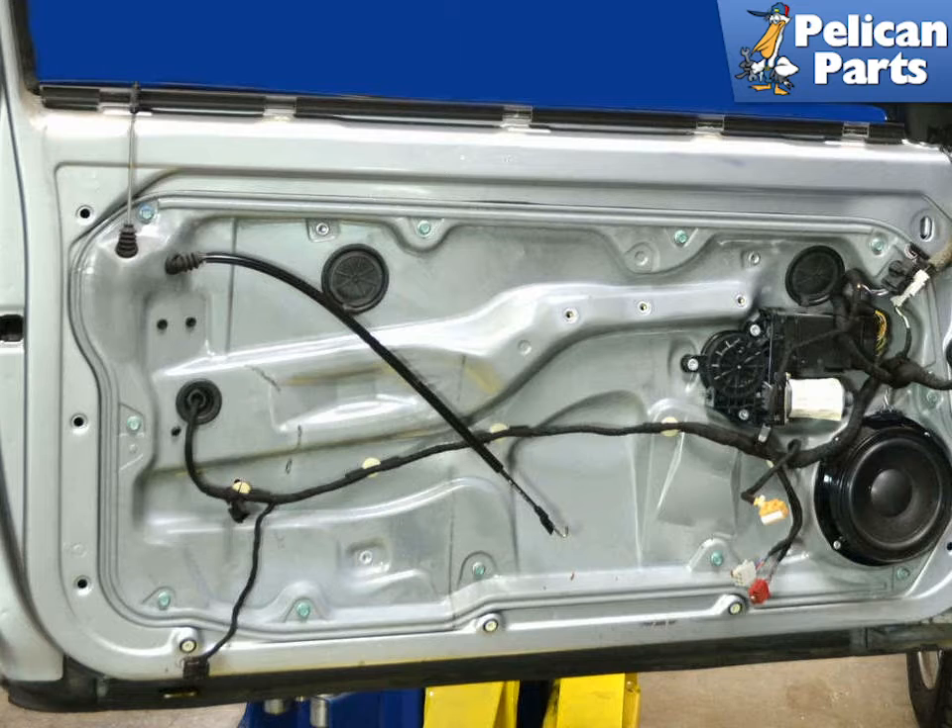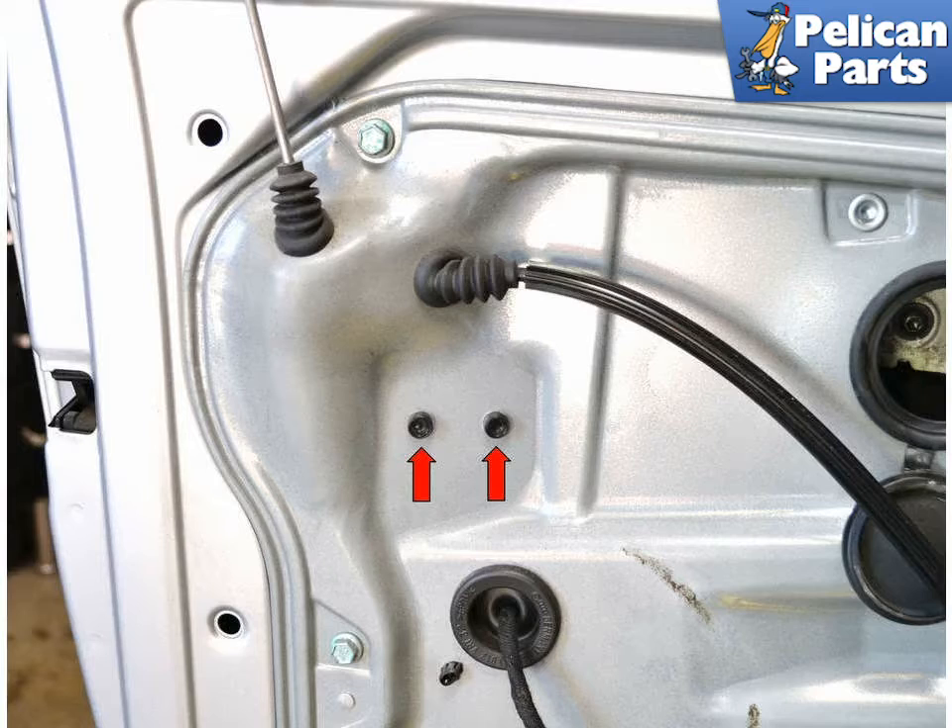This photo illustrates the door with the door panel off. The first thing you want to check is the upper left corner. If there are two plastic rivets, then the door lock assembly is attached to the panel that the regulator is attached to as well.